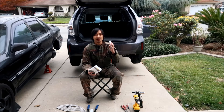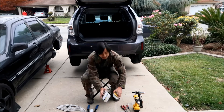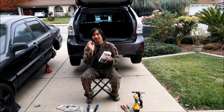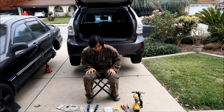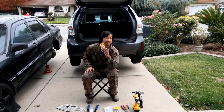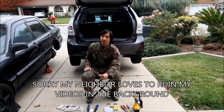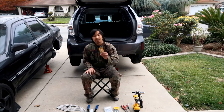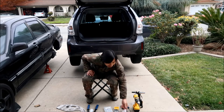I also used a cutting wheel to cut off a rivet tail — it's aluminum so it's easy to cut. I had spare quarter-inch and 3/16-inch rivets on hand just in case you mess one up. I wish the kit included one or two spare rivets. I got mine from Harbor Freight. They're slightly different from the kit rivets but they work fine as long as the head covers the hole.